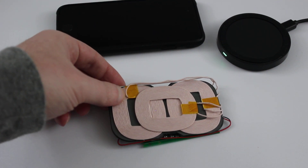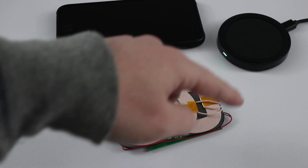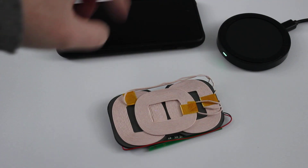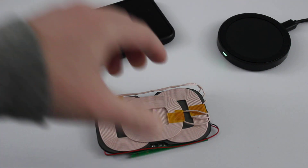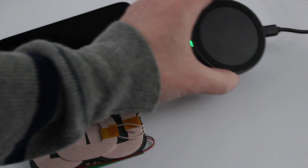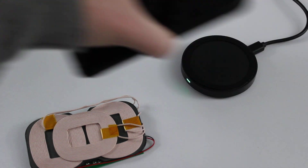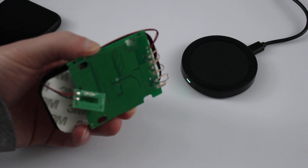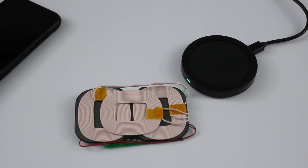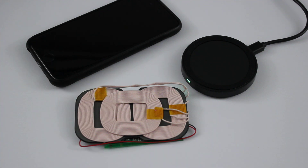This was about $20, which is a bit expensive, but that's mostly because it's a 3-coil charger. That just means there's a wider range, so when you put your iPhone on it you can offset it a little bit and it'll still recognize it. Whereas this charger right here is most likely a single coil, so you have to be fairly accurate with placement. You can get a single coil version for about $10. I'll put all of this info in the description and a link where you can learn more about how to make your own iPhone wireless charger. Thanks for watching.